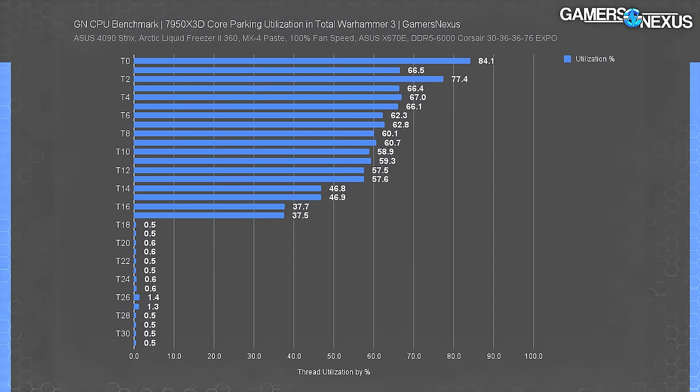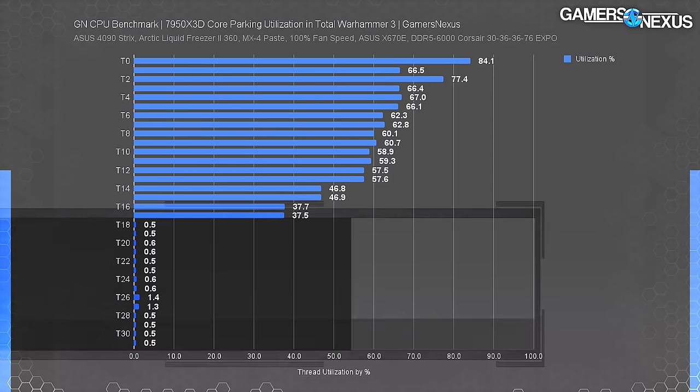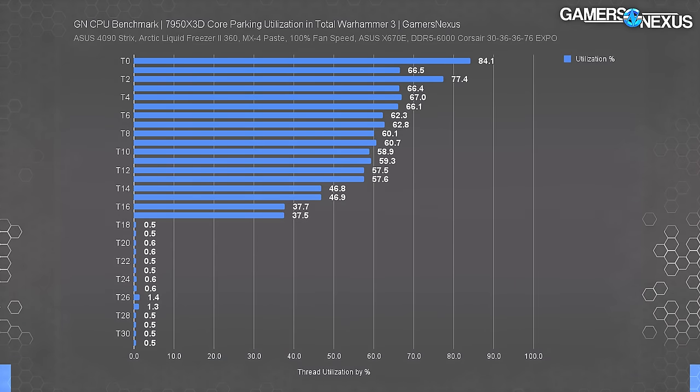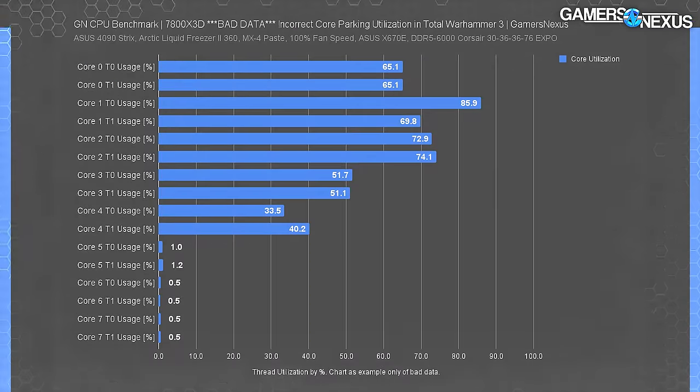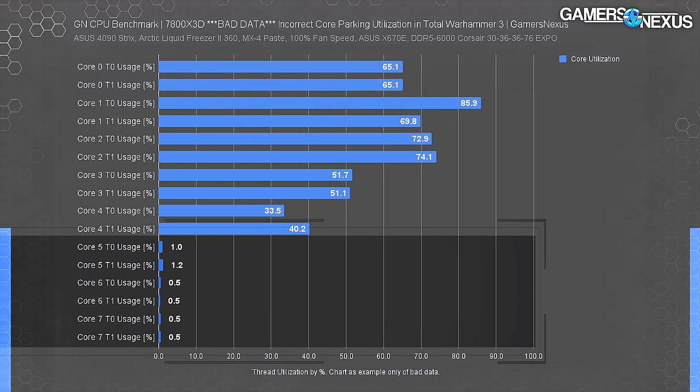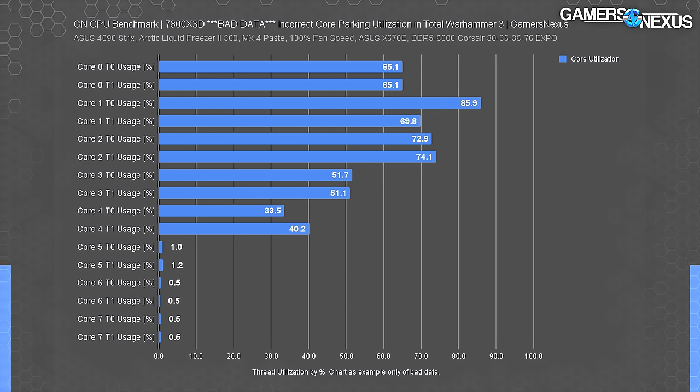Here's an example of why that happens. On the 7950X3D, half the cores are parked during gaming — that's intentional and good for that chip. But when we tested the 7800X3D on the same OS we used for the 7950X3D, even after a full manual wipe and reinstall of chipset drivers, the OS remained contaminated by AMD's core parking add-ons meant for higher-end X3D CPUs, so half the cores on the 7800X3D were parked too. That ruins results if the tester doesn't notice it. We installed a new OS, which resolved the problem completely.